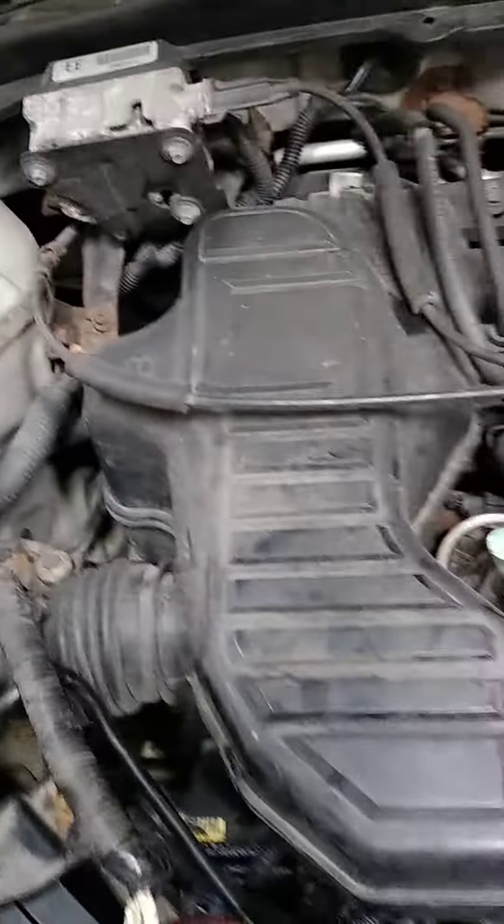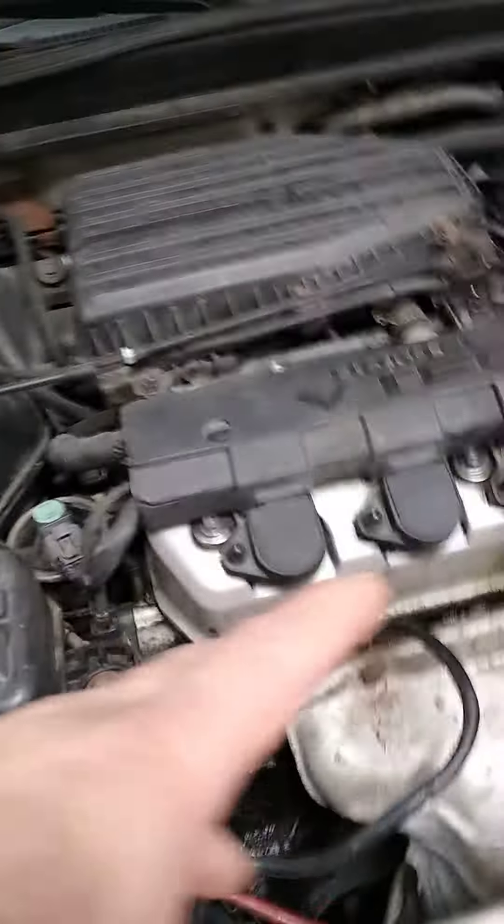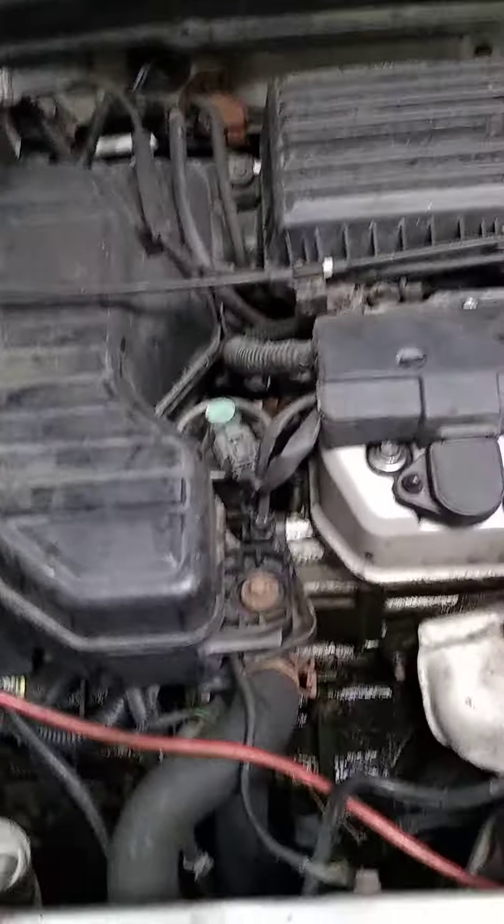The little wire should be to chassis, so that's down to the chassis. This is probably the best charge that I've seen on a vehicle in a while — with us moving the grounds around, upgrading, changing the ground position, and upgrading the charge wire.